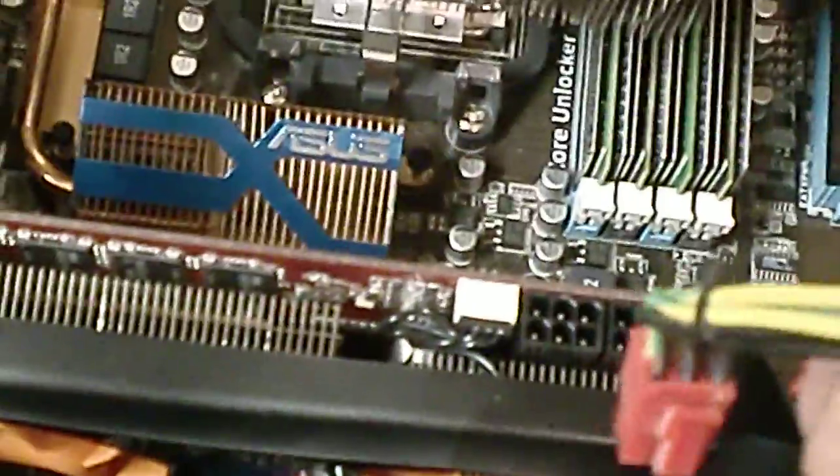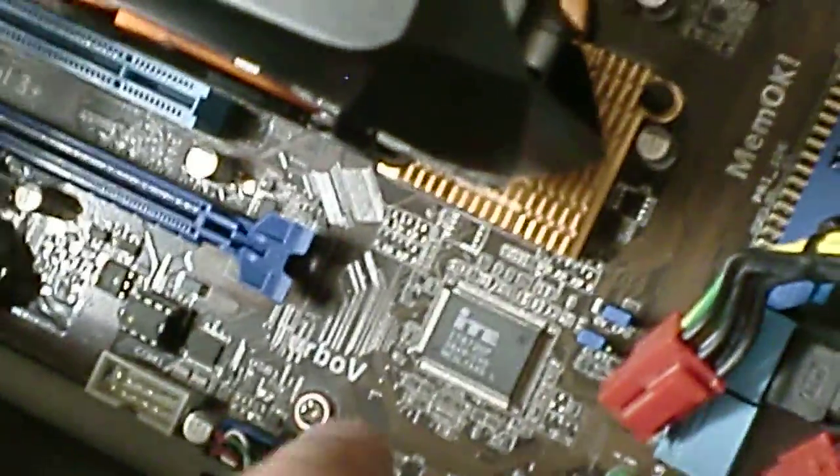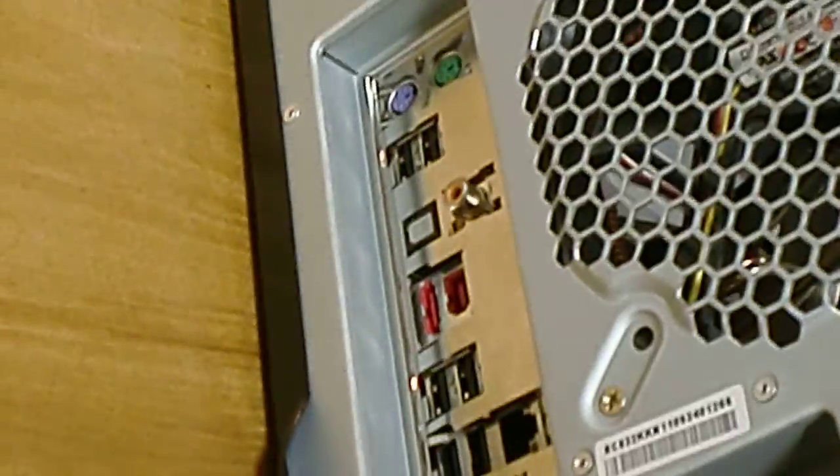The funnest part is hiding the cables, like you see I have running back behind here. Same thing with the main harness, it's running up behind my case. And these cords will be utilized to plug into the graphics cards that I have on there like before, which I'll show you. The cable management is the end of the perfection, so don't focus on that too much in the beginning. But also right here you'll see audio, HD. All those pins are normally at the bottom of your motherboard, as well as the front USB ports, because the back ones are naturally going to have their own spot when you put it in there.